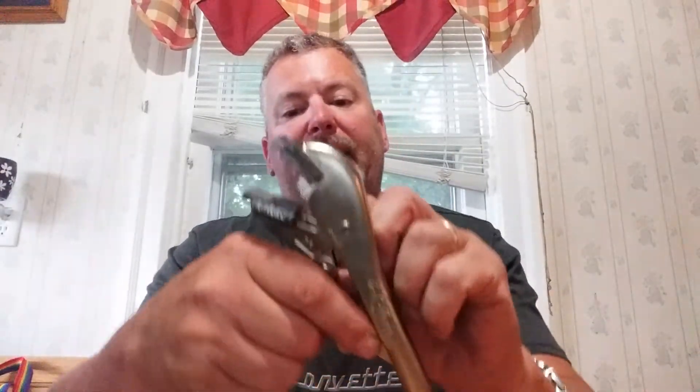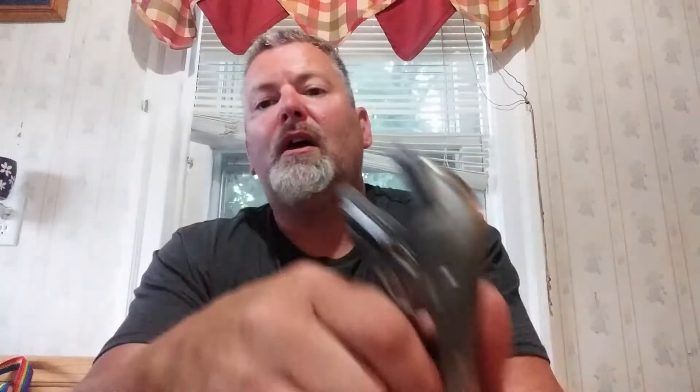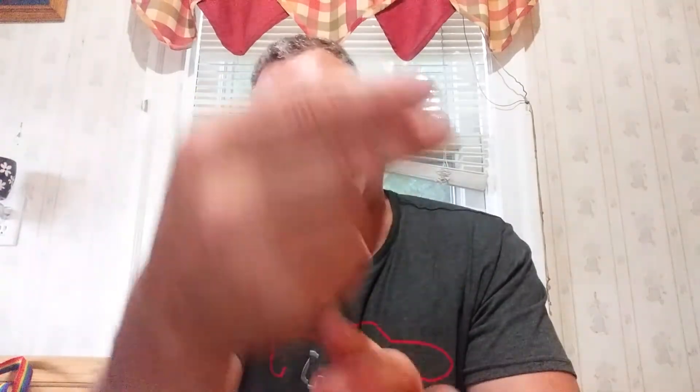So what this tool does is you slide it on there back against the back edge and you crimp it down. What it does is it takes your fender and actually puts a bevel — that's exaggerated — so that way when you set your repair panel on, the edge of the repair panel theoretically should set down in the recessed part, which will make it even with the existing fender or whatever area you're fixing, whether it's a door, the fender, tailgate, you know.